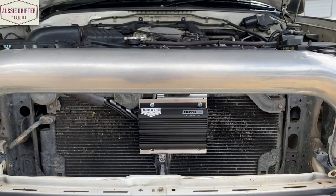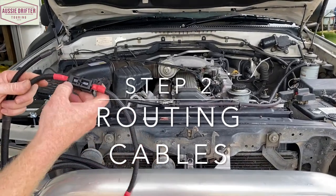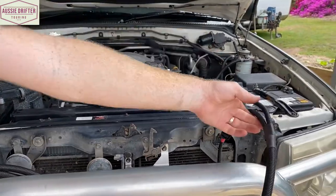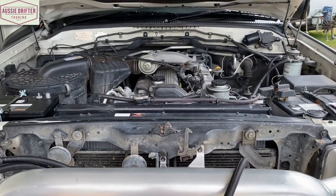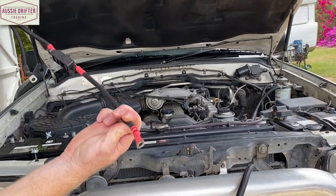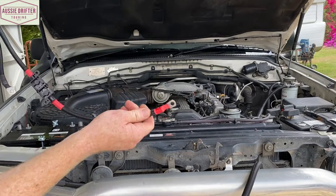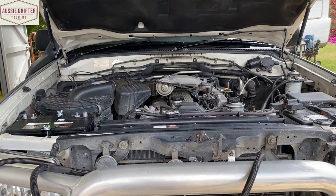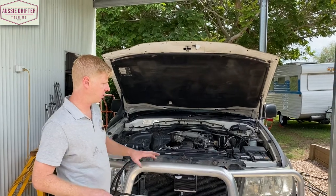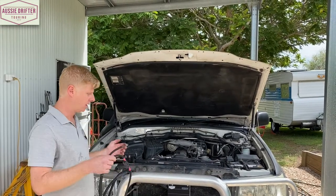Now that we've got the charger fully installed and secure, we can start to route our cables. Looking at the harness, this one is labelled 'Redarc main' and also on the end of the fuse holder 'main battery' — so that's going to head over to our main vehicle battery on the passenger side in the 100 series. Our other harness includes an Anderson plug and is labelled 'Redarc auxiliary' on both parts. There's plenty of length on these cables because some vehicles may have other accessories installed, like spotlights or a transmission cooler.